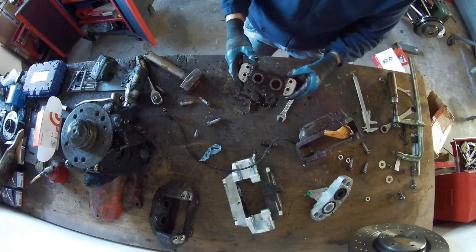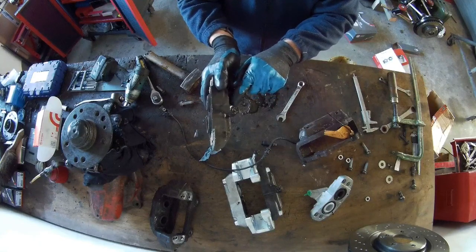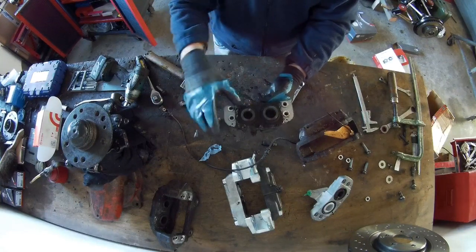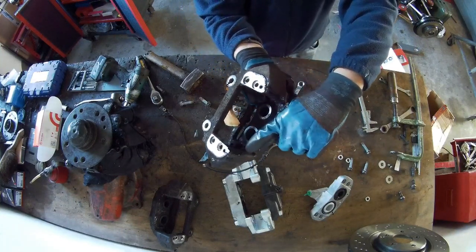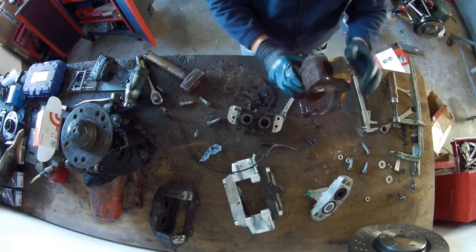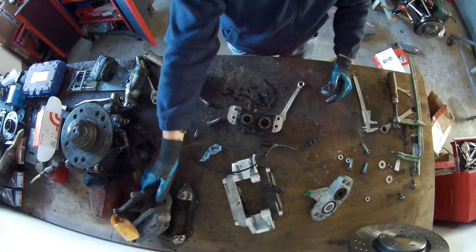A brake caliper is a very easy device. The only thing it does is put oil pressure in here, behind the two pistons, and it feeds the other side through the two holes into this side. So the holes go through here to the other side, into the other system. It is always mounted with the breather hole to the top, so you can let all the air out. It's just a very simple device.